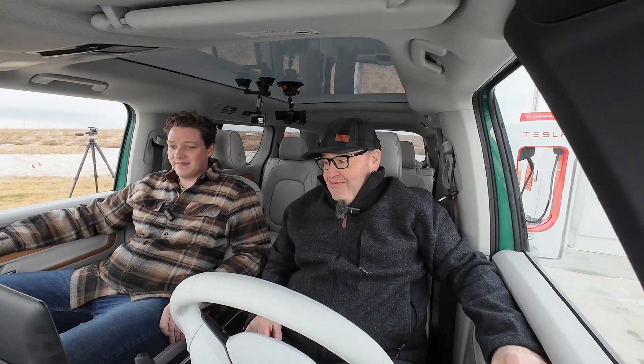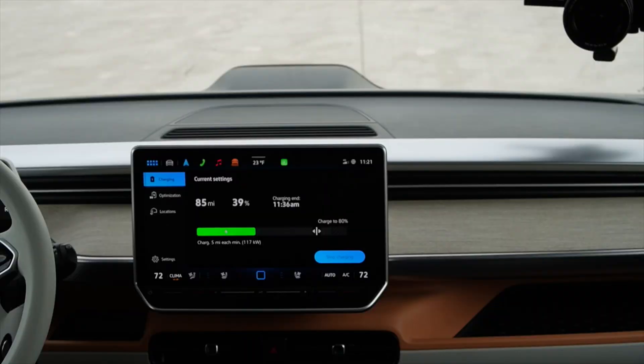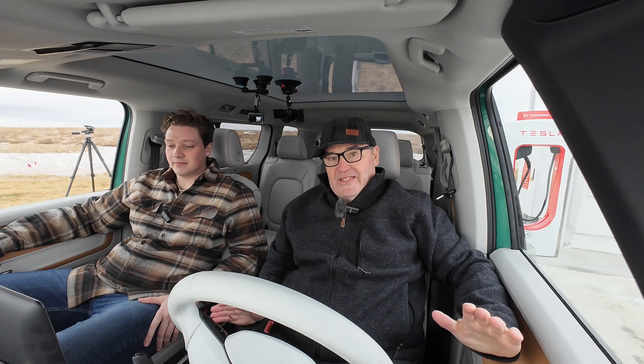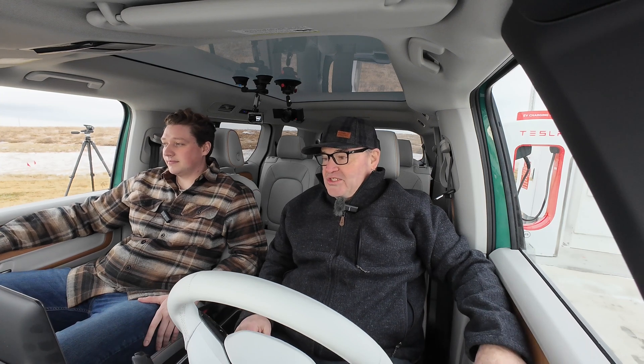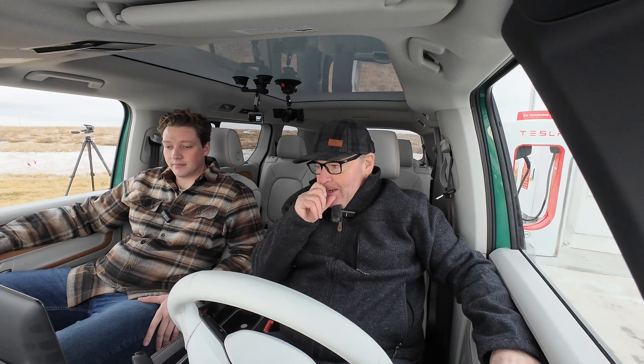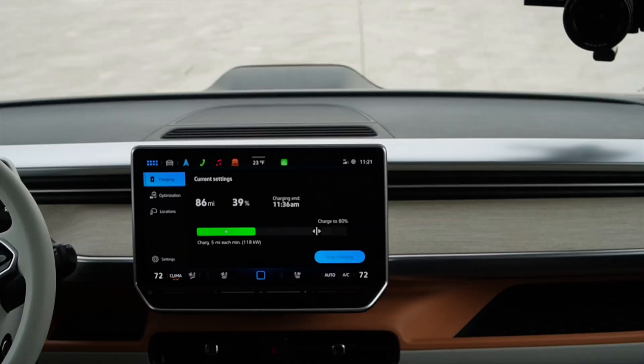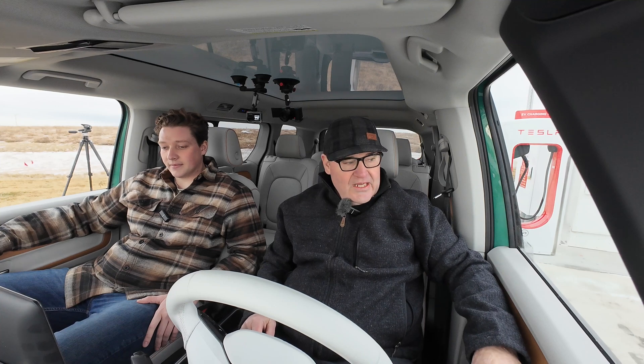After another quick bathroom break — I'm 65 — Alex stayed in the car because he's not 65. Right now we are at 39-40% battery. It's 23 degrees out, a cold day. We've dropped to 119 kilowatts at 40%, but that's still 10 kilowatts faster than I would charge in my Ioniq 5, and I suspect far faster than I would be charging in an ID4. That's respectable.